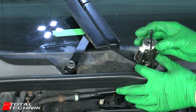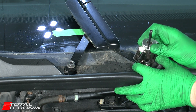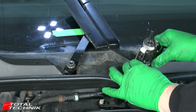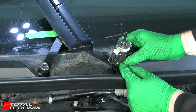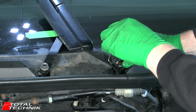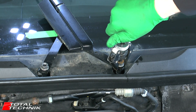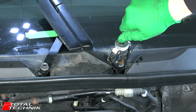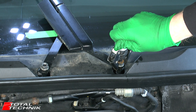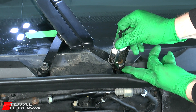The first thing I'm going to do is use the silver part so we get that tucked underneath and get a good grip on the arm. Now because the hole in the top of my nut is very similar to the end of the tool, I'm just going to put a coin in the gap so that we've got a solid base to push against, rather than just pushing against the center of that nut. Then just start to apply the pressure. And you can see that's now free.